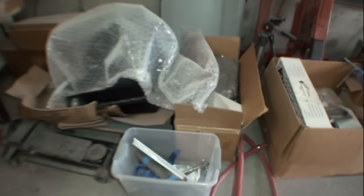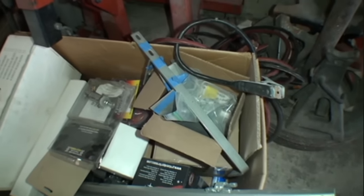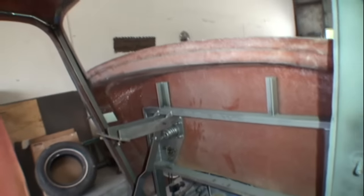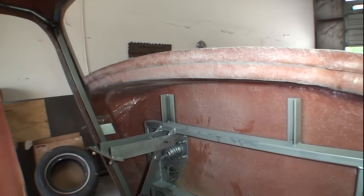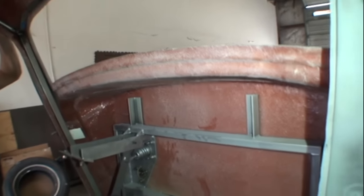Follow me, bud. All right, what we got here is a situation that says not all of our steel is installed in the car. Oh, those. We got steel braces and brackets. We got to weld these in. Okay. So tomorrow morning, first thing, my friend Pete's going to hook you up, show you where they go, and you're going to weld them in. Cool. We also got to weld in a bar. We got to get a 2x2 bar welded across in there. And we also got to weld some nuts on there, some bolts for some ground action so we can put our ground wires on so we can get this thing in gear and ready to go.